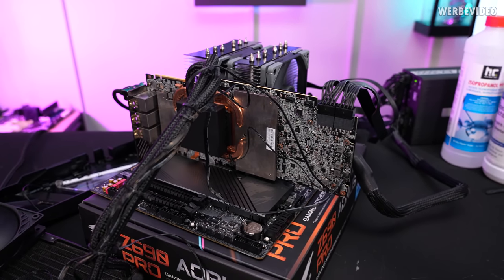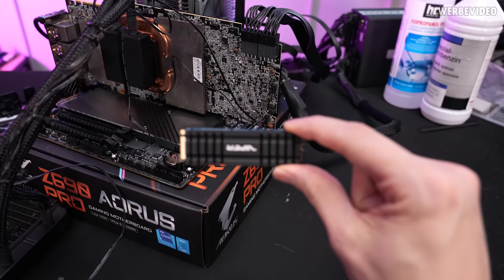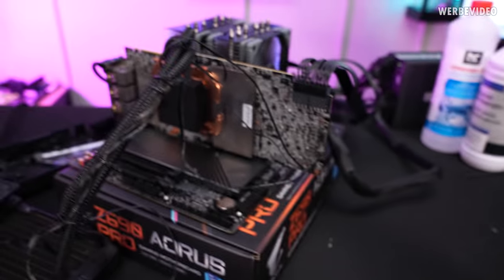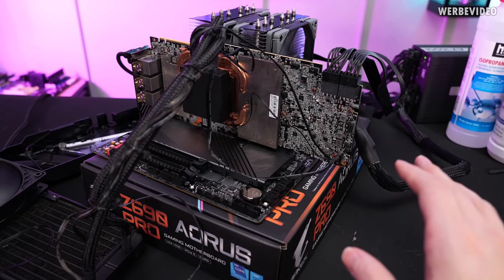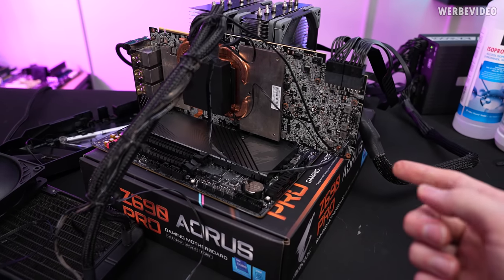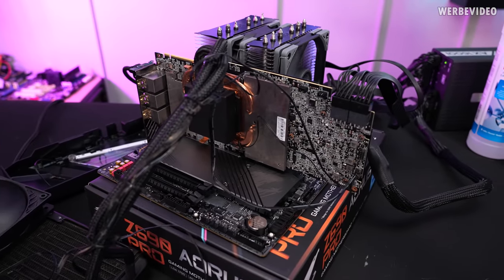Since I'm not 100% sure what was going on with his drive, I decided to simply place a second drive inside his system. He's getting a Viper 2TB Gen4 NVMe in addition, because his main drive was also only 250 GB in capacity, which isn't that much anymore nowadays. So he can access the data on his old drive as a second device and use the 2TB as the main drive.